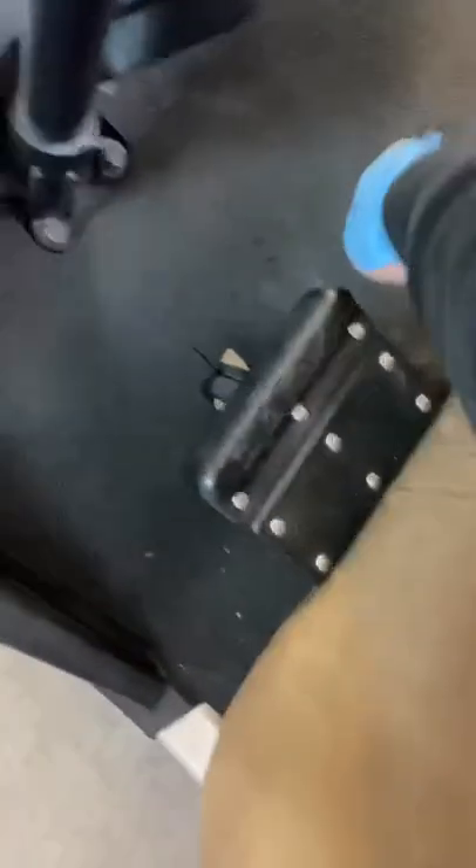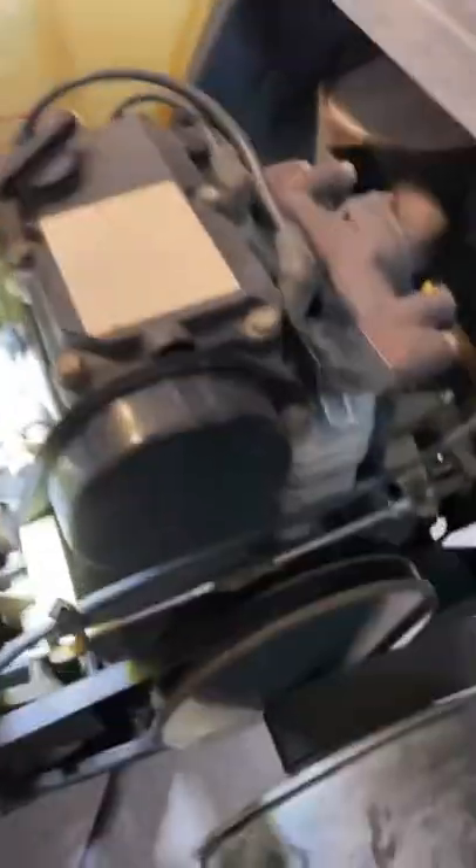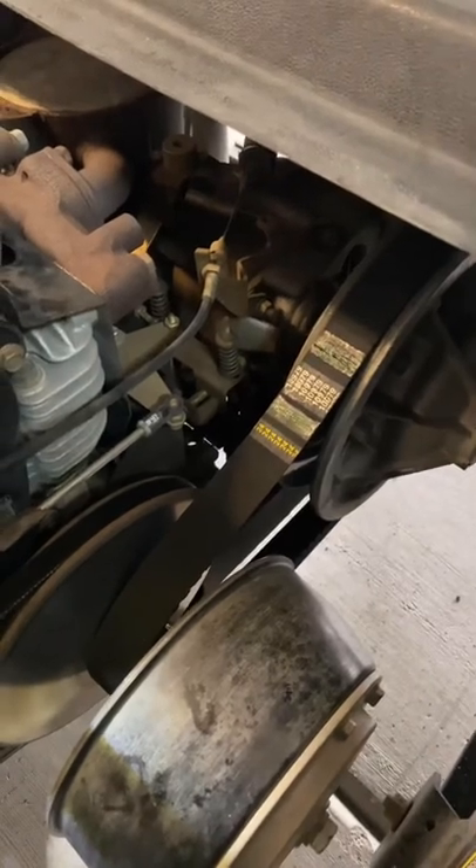I'm back. So what you're going to see is I got it on the bottom. Up around, and then I've got it off right here. So you'll see right here it's getting a little tight. What I like to do at this point is you want to take the brake off. Just tap the throttle there, get the brake off, put it in neutral. Take your gear shifter and put it in the middle so the golf cart rolls. And then what I'm going to do is work this thing and just try to pull this belt. You'll see right here as I'm pulling this belt — and once I pull that belt, I got it on. Now that belt's on, there's nothing else you're going to need to do. That belt is on, it's ready to go. It's that simple.